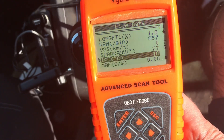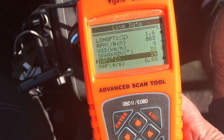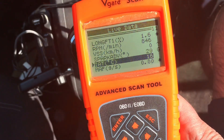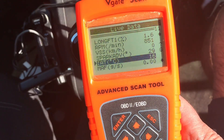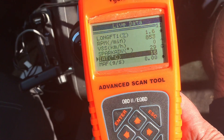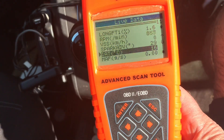For the price of sensors, I'd probably go for a genuine sensor — I wouldn't get anything aftermarket cheap. Check your wiring, check your connectors. Obviously, if you've got a wiring problem, you could have an ECU problem, and you could be at this all the time. But normally it's probably the actual sensor that's gone, so it might be worth checking that first, making sure that you've got good resistance on it.